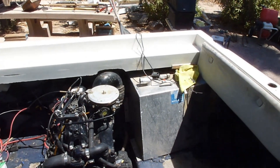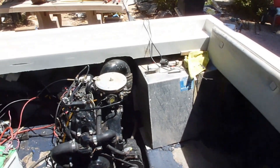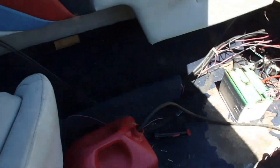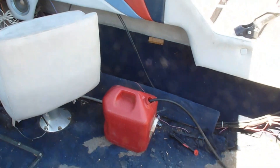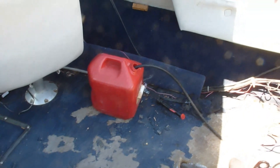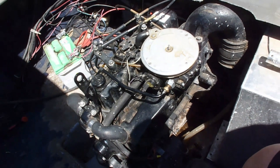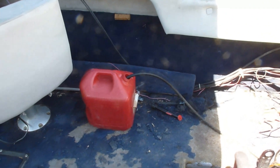I pulled out the fuel tank because it's been 12 years, so I'm going to clean it out. I'm running off this external gas tank here. Now I'll embarrass myself — it wouldn't start for like two days and I couldn't figure it out. I went through all the electronics, then I pulled this fuel line off to see if I was getting fuel and I wasn't. I readjusted the hose in the tank — the hose had curled up and was sitting above the fuel level, so it wasn't getting any fuel.